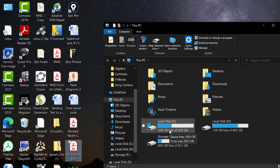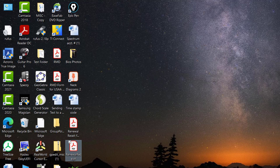This right here is the Samsung that I just showed you that I bought on Amazon. In case you haven't done any cloning, you can always clone from a smaller disk to a larger one and vice versa, as long as the data you're transferring will fit in the other drive. So if you've got 600 gigabytes and the target drive has only 500, that's not going to work. But Acronis makes it easy — it handles all the partition setup. So I'm going to do the clone the other way around, and I'll open up Acronis True Image.